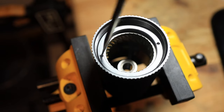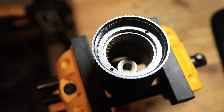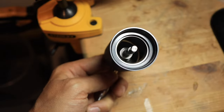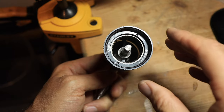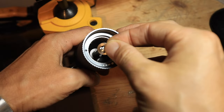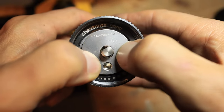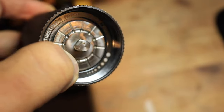Before we had to turn clockwise to loosen, so we go counterclockwise to tighten it now. I'm going to be quite curious how it operates. Let's see how it spins now — I think it spins a little better. To put this together we just drop the washer on, then put the spring on, then comes the burr, then this part goes on there — put the nose in as it belongs, get it oriented right — and just one more part: put that clicker on.